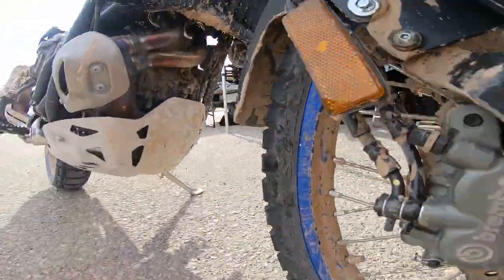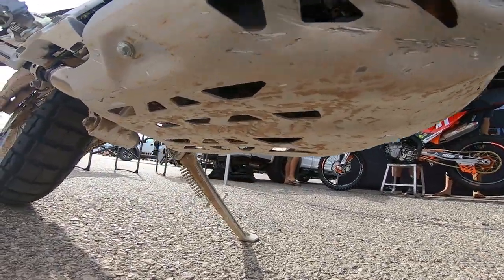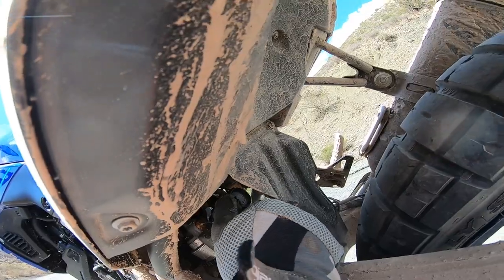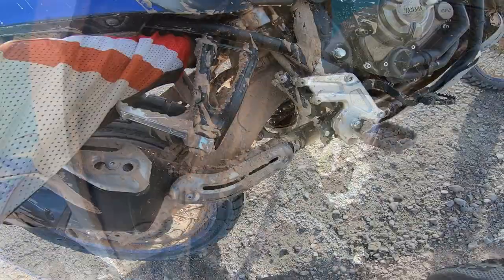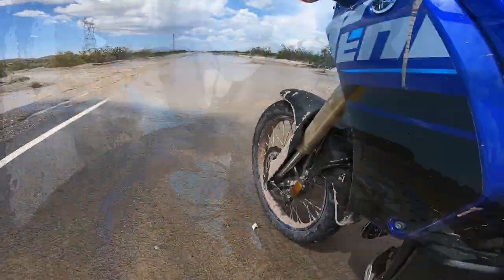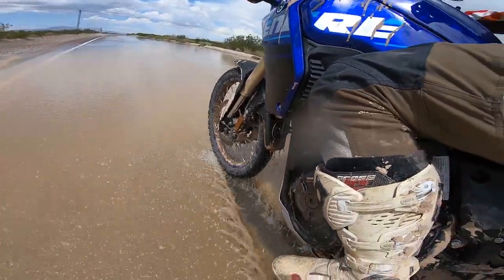Here is a look at what it did, and it just reminded me that sometimes I get in a little over my head — that's why I need a good skid plate. Then we went on to suspension tuning. I clicked around; typically I was going less on rebound and a little bit stiffer on compression. I also backed the shock preload down a little bit after I made this modification and it all worked out. Overall I've got a pretty good idea of what I'm going to do next.